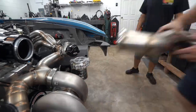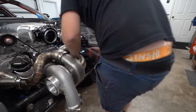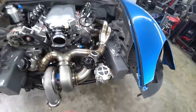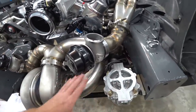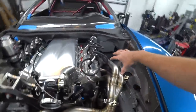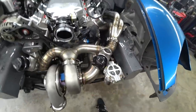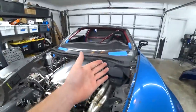We put the filter in first to check if the downpipe could go in with it — not a chance. So we pulled the filter, put the downpipe in first, attached it to the exhaust, then put the filter housing back in. Filter housing is mounted nice and secure. It's close to the downpipe, but we're going to do a lot of heat management on all the exhaust. The downpipe post-turbo will be around 800 degrees versus maybe 1300 degrees at the header, so despite being slightly closer, it's actually cooler here than our other considered location.